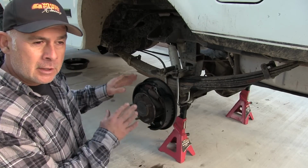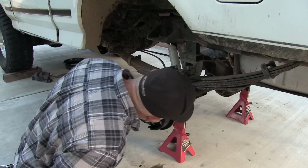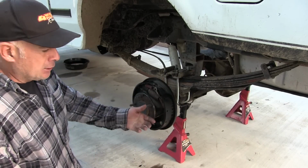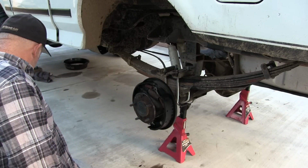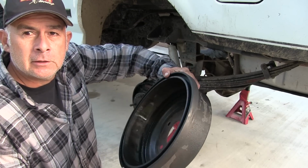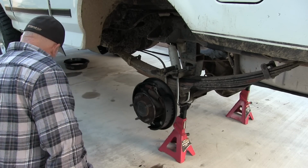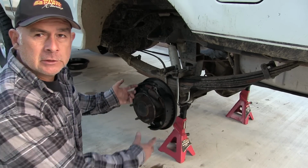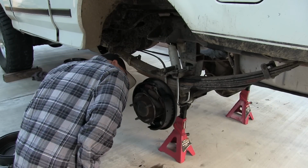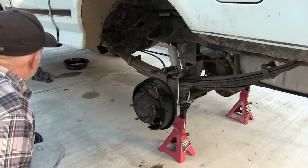Everything's okay. My brakes are together. I thought they were dragging or something, so I gave them a spray of brake cleaner, but they still look like they got oil on them. The drum definitely needs to be cleaned. That's cleanable, but the brake shoes aren't. The oil soaks into the material of the brake lining. I don't see any damage. That should be okay. I hope.